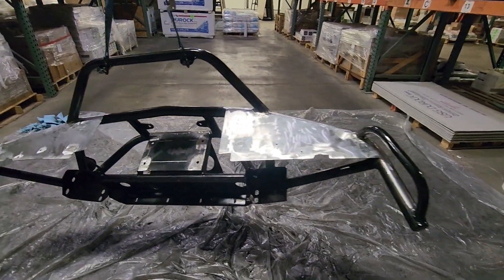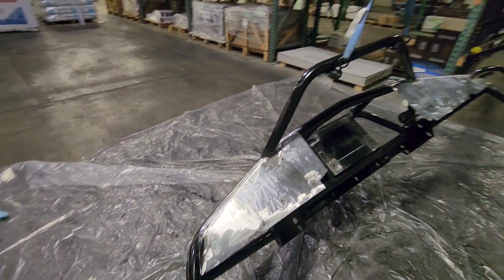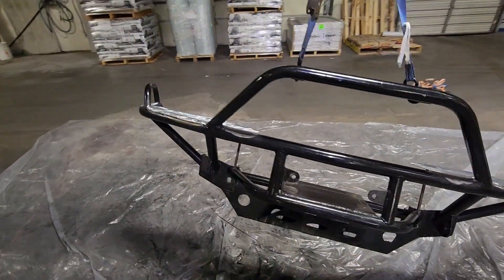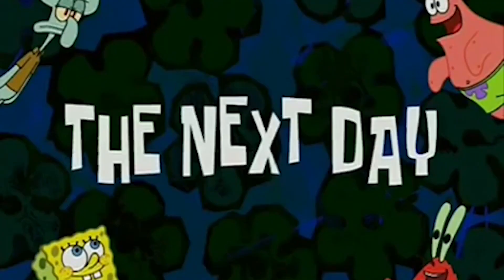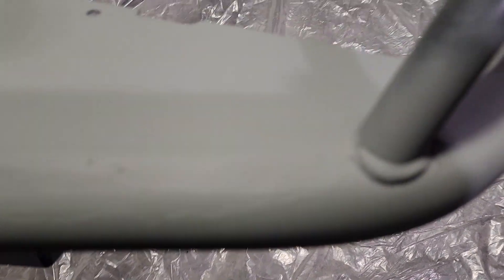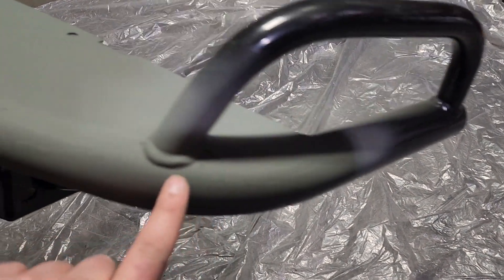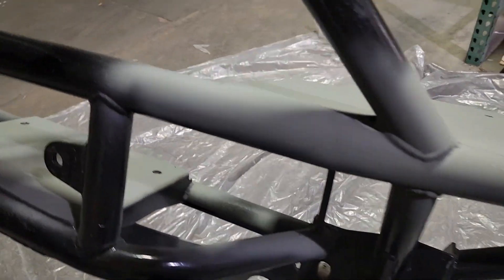Before video of the bumper — just finally got it all cleaned out, cleaned off, and wiped down. She's looking so good, and she's going to look brand new when it's done. So let's get some self-etching primer on it. We're back and it's been primed up pretty good, but you can't really tell on camera. There's primer like this everywhere, so we're going to give it a little sandpaper action from the paint burning off the original. I did sand a lot of it down, but still a lot of heat, so I'm going to sand that and make it a little nicer.